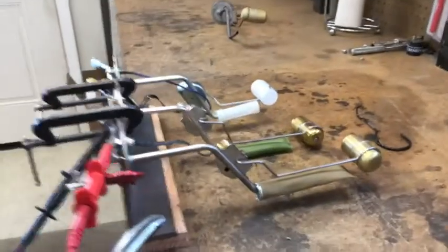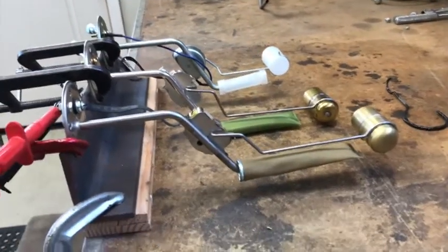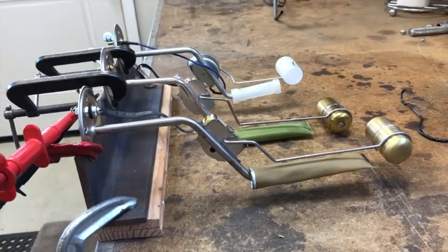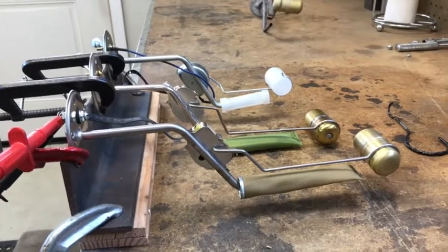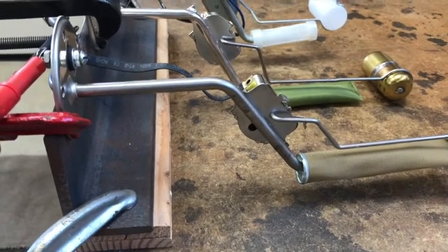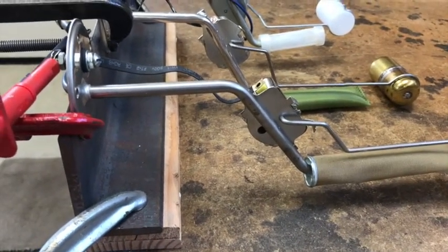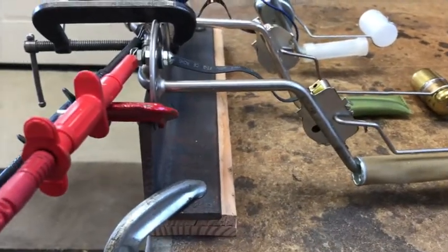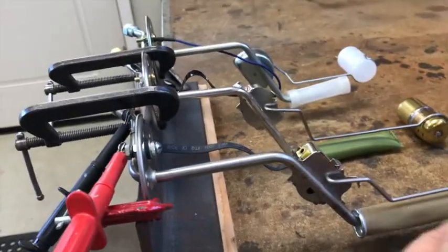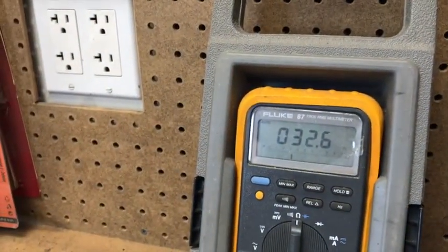Essentially, this one on the end is set so it reads almost zero when the float is touching the bottom of the tank — I think the rheostat goes to three tenths of an ohm where it's reading right now. That second unit — the middle one — I have that float arm straightened out so the float will be close to the bottom. I haven't put that in this tank yet. When you raise this float all the way to the top, it reads close to 33 ohms. When I pick this one up — I'll change the leads — hang on.